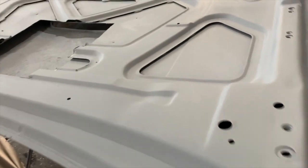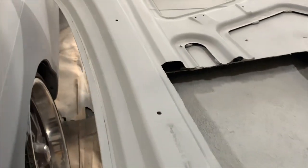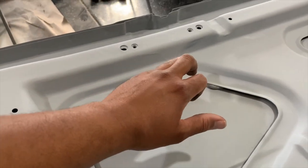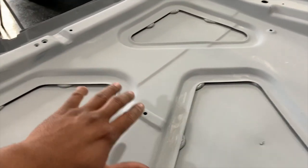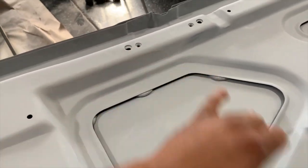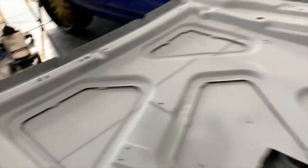We're gonna have to go ahead and hit it off with some of the self etch primer. Reason why I'm using self etch is because I don't want to seal. And the self etch is pretty much the same as this primer. It's the same color and everything. Probably I'm gonna have to knock that down a little bit more, but that's the only run that I have. But yeah, we gotta knock that out, get that all done.